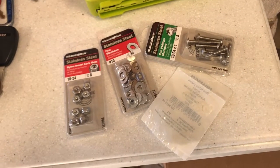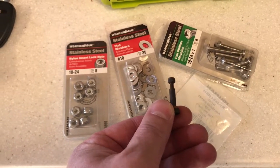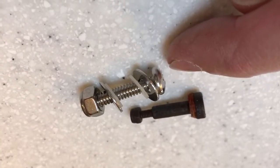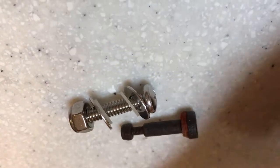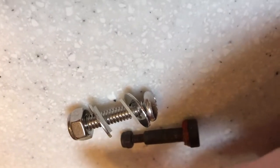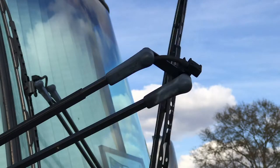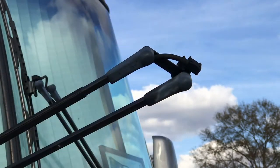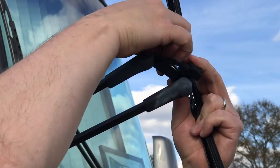We're back at the ranch. You can see the assortment of stainless steel hardware we've got. Hopefully from this we'll be able to replace the weak link in our windshield wiper saga. Here you can see the old and the new. In the new setup we've got a stainless steel screw, stainless steel flat washers, nylon flat washers, and a stainless steel nylon locking nut. This should provide a much better setup in the long run. The hole on one side of the bracket is just a teeny bit too small, so I'm going to have to bust out the drill and make that hole just a little bit bigger.